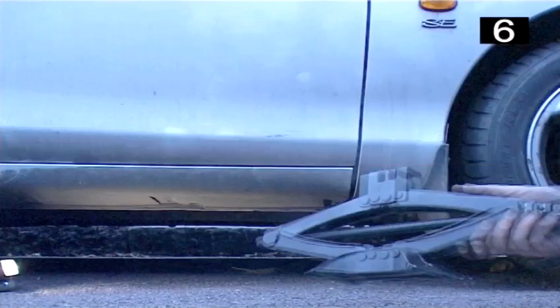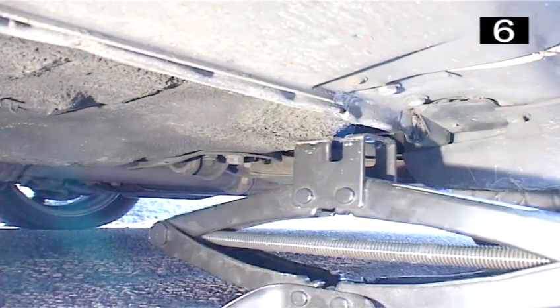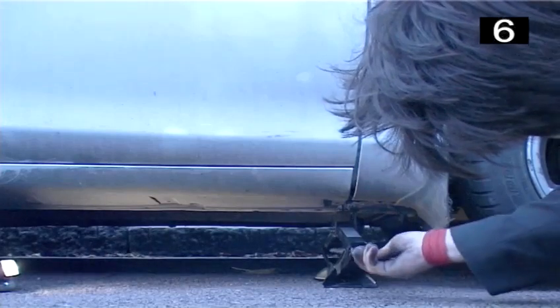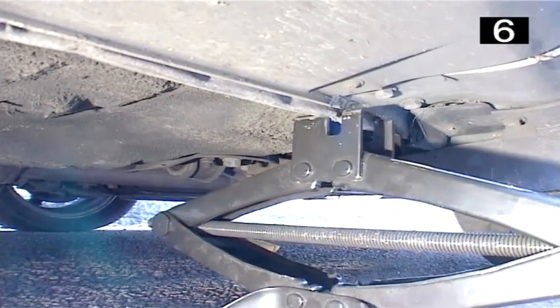Step 6: Positioning the jack. You will need the jack to raise the car so you can remove the tyre. Firstly, find the jacking point — this differs from car to car, so use your user's manual to tell you where to find it; it's often found here. Watch out: if you attach the jack in the wrong place, it may go through the floor of the car when you start to elevate it. Also, if the car is parked on soft ground, place a board or carpet from the boot under the jack to prevent it sinking into the ground under the weight of the car. Once the jack is correctly positioned under the jacking point, wind it up with your hand until contact is made.